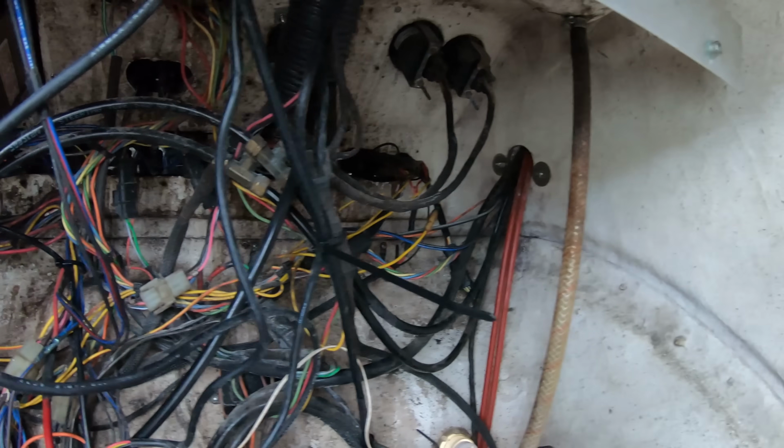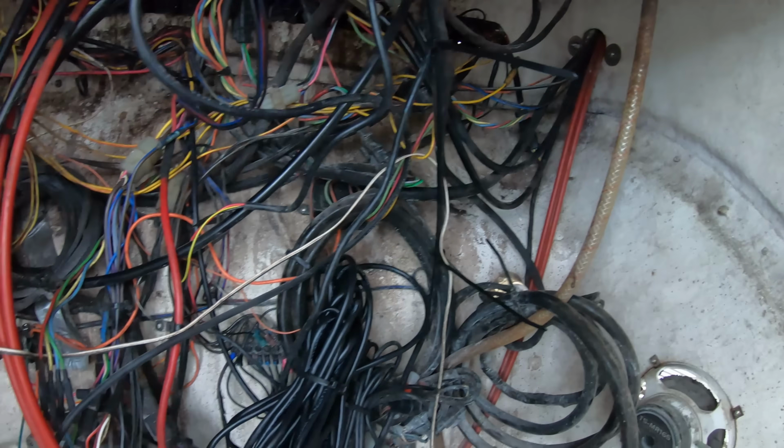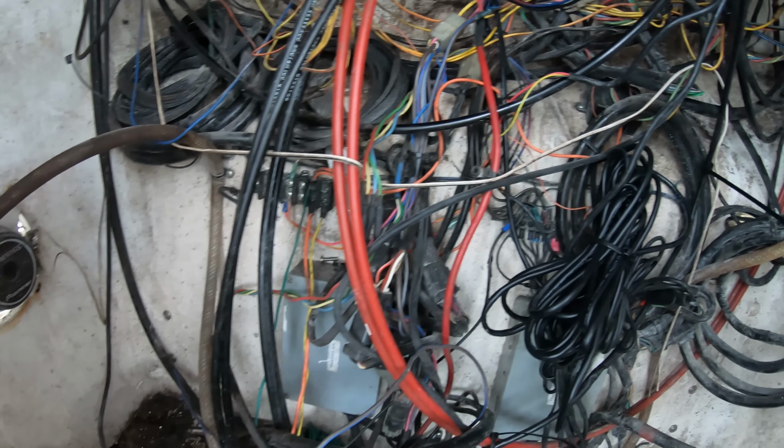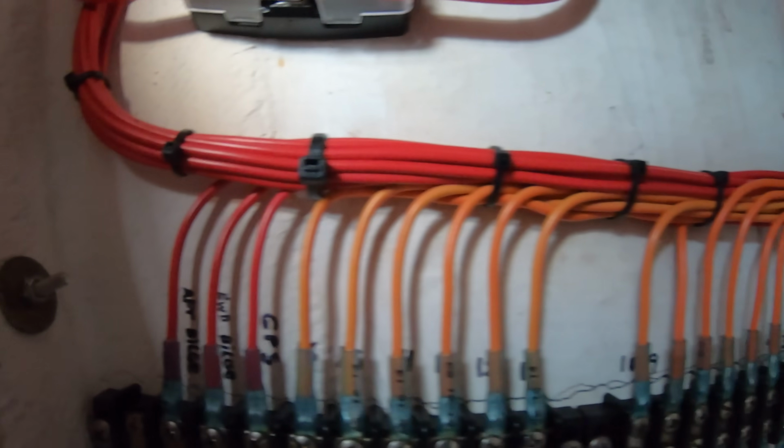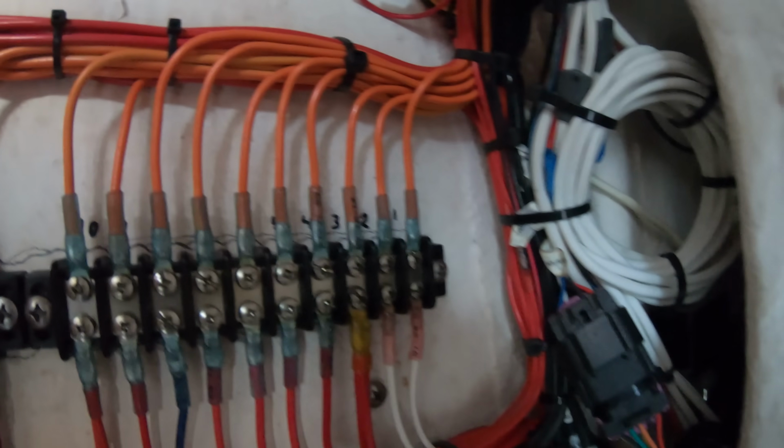If you start to see home electrical connectors like wire nuts or really green and corroded wiring, take note that someone will be working on this wire in the near future, and if you want it to be you or not. These are places for failure and hassle, so it's important to inspect the wiring that is around the boat to make sure it is clean and appears to have been installed correctly.